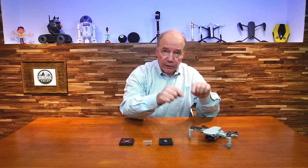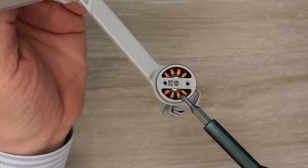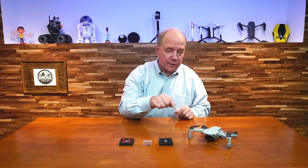But if you're asking me, should you be using a set of motor covers with the Mini 2? The answer to that's easy: absolutely. And the reason for that is if you look closely at the motor, take a minute and pull the props apart and look down inside. What you're going to see are those orange circles — that's the armature of the motor. It is protected somewhat by shellac, but everything else is totally exposed and it's the perfect collection point for debris when you're flying, because you're not flying through perfectly clear air.